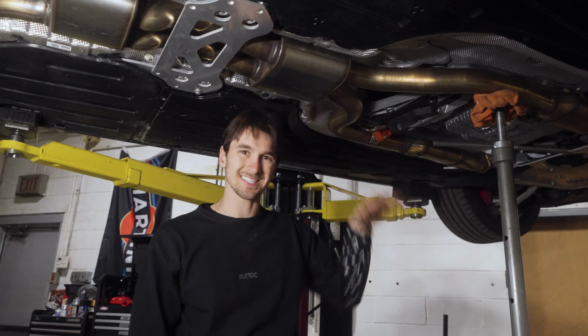We're gonna have to do this by hand with a 13 millimeter socket. It's gonna be tricky, but it's the only real way to get up in there to make sure that it's properly tightened down. This one is a little tricky. You gotta do this by hand, and then we'll get a 13 millimeter wrench on that. Then we're also gonna have to do this top one by hand. So this one, you can see, once we got it on the threads, you can move it a little bit by hand, which is nice, but ultimately you're going to need one of these.